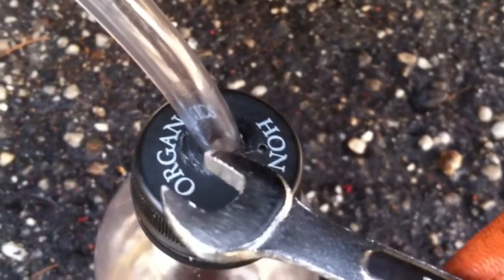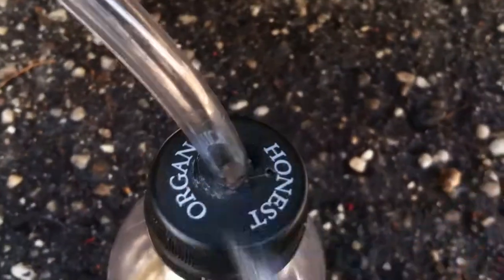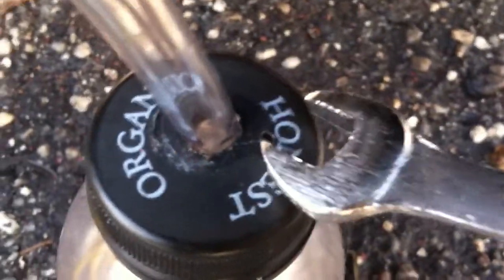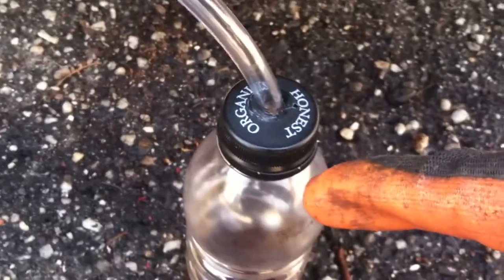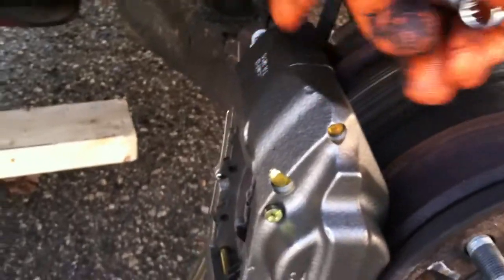Juice bottle with a hole and a hose. The hose I got from Home Depot is connected to my brake bleeder valve. As you can see, I got a big hole right here for the tube and a small hole right here, so that way the air can bleed out of the bottle instead of feeding the air back into the tube, back into the brake system.